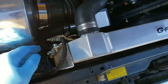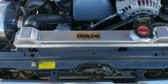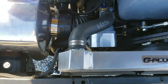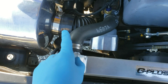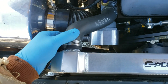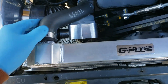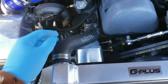This is an aluminum aftermarket radiator from Amazon, about $150. The only modification required was this tube was angled, so I cut it off, shortened it a little bit, and welded it back on straight. I've seen some V6 radiators with a straight inlet and some are angled, so it's got to be straight. Then this hose fits really nicely to the engine.